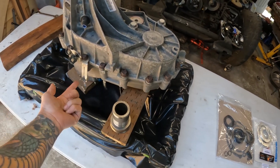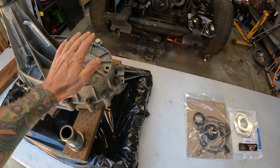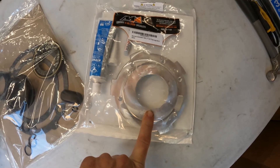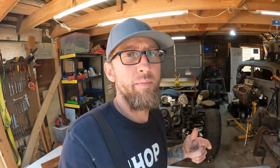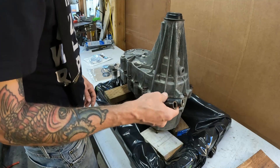This is a 32-spline, whereas the one currently in it is a 27-spline — it's made to work with the 4L60. We've converted to a 4L80, so now we've got to swap this in. At the same time, we're going to throw in a new pump seal kit, which should be nice and easy. Our first problem is the bolts are really rusted up. They put a plastic covering on it and it has basically rusted them badly, so we'll see how that goes.